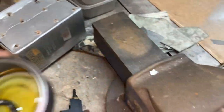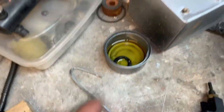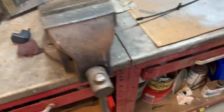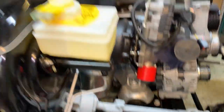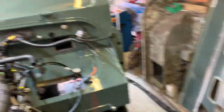I did get the Brit Part hose and put it in diesel for two weeks — it hasn't dissolved at all, so maybe it would have been okay, although I was told it does split. I don't want to take the chance because once the body's on, getting to that tank is a nightmare. There's a nice new master cylinder on there now. I put some silicone sealant around that joint where it leaks and gets the paint off — might help, we'll have to keep an eye on it. It's a crap design. The engine is looking all pretty and the wiring on the bulkhead is all done.